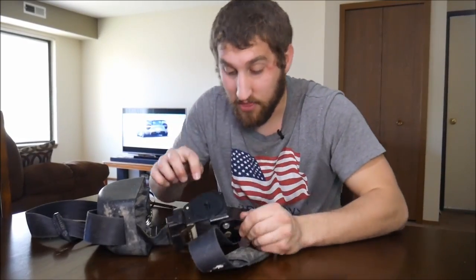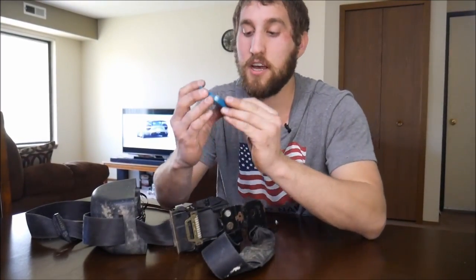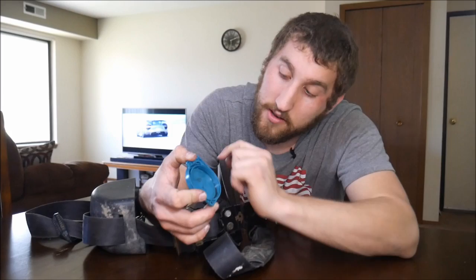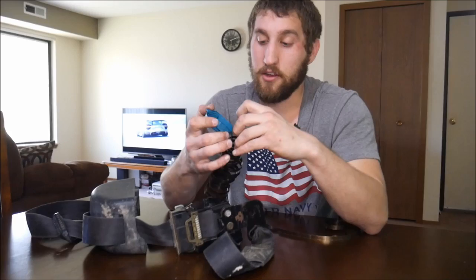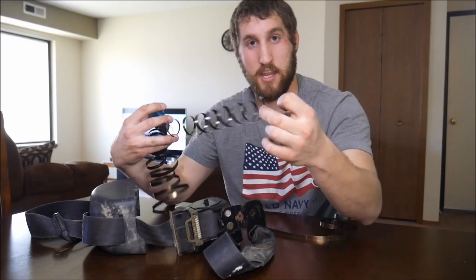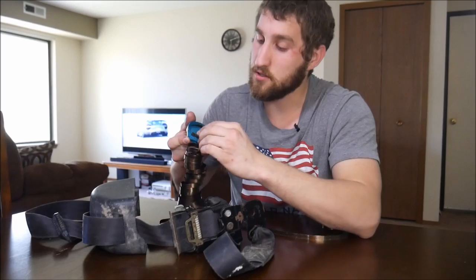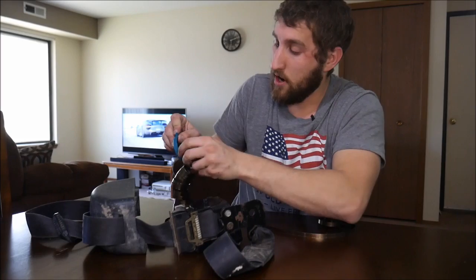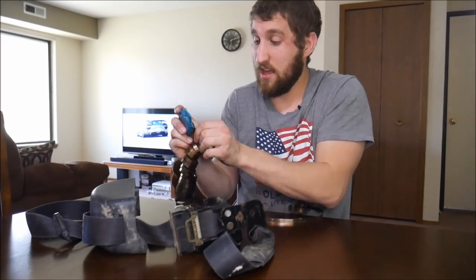Okay, so on the shaft of your seatbelt, there's a notch. And on the outside of the cover, there's a little area there that this spring is going to go into. Now you're going to want to take this spring and go, if everything's spiraled this way like it is, we're going to wrap it the opposite direction. So slip this down into there like so, and wrap it around the inside here, just like this.